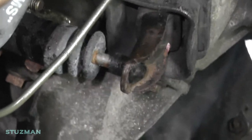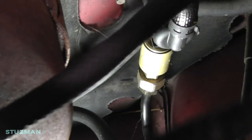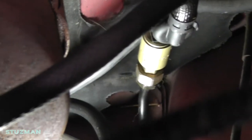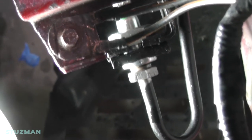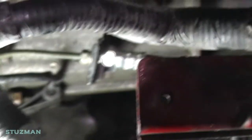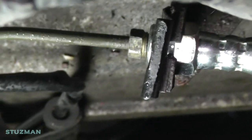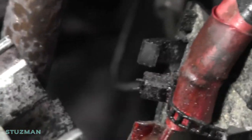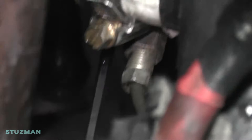It's looking pretty good and I've checked around for leaks — I didn't see any. Here at the master cylinder, I've looked over that really good while she's been pumping it quite a few times and I do not see any leaks. Let's check the other fittings. Soraya, go ahead and pump it up. That fitting looks good. Looking down at this other fitting down there — looks good. And of course on the clutch master cylinder — down there, let's get some light on it — looks good.